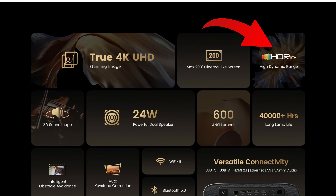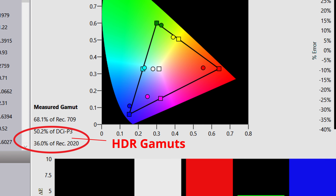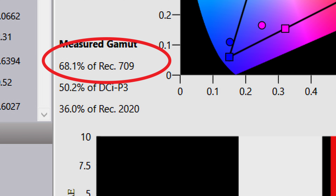A lot of people equate 4K and HDR together, and in fact this projector says it does HDR10 Plus. That's not what I found in my testing. I only got a color gamut of 68% of Rec. 709, which is SDR — not HDR — and that's actually the second lowest I've ever tested out of all the projectors I've reviewed. I reached out to Paris Rhone and they said it depends on how I test it, but when you test colors you test colors. I put on 4K HDR content and I did not get any HDR settings or additional colors. As far as I can tell, this is an SDR projector at 68% Rec. 709 and it is not an HDR10 projector — it is, however, 4K.